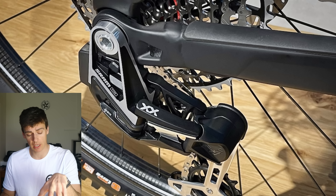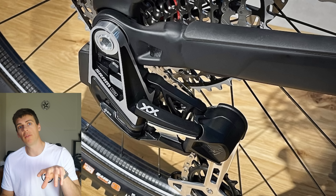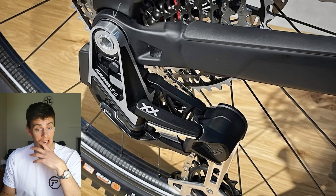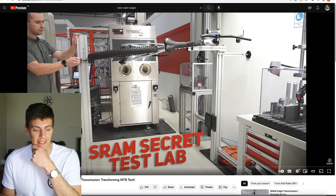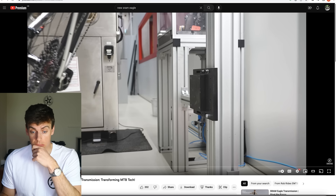This is a SRAM picture from one of their press releases — credit to Bike Rumor. This is a full-suspension bike with a pivot at the rear axle, a chainstay/seatstay pivot, quite common on a four-bar linkage. SRAM think it's okay to pass hundreds of kilograms of shock loading into bearing races. I would much rather take that on a mech hanger, snap the mech hanger, and save the linkage bearings in the frame. Let's take a look at what a successful test looks like in SRAM's language.